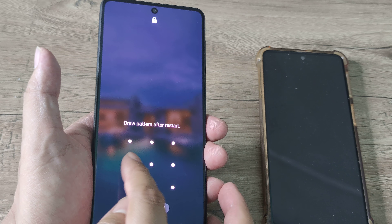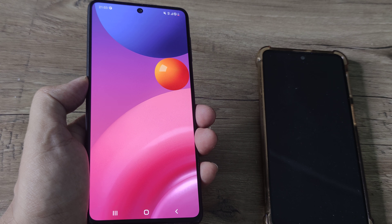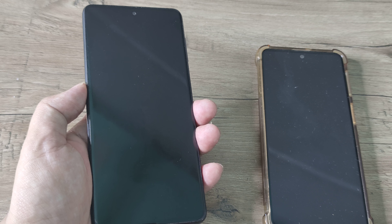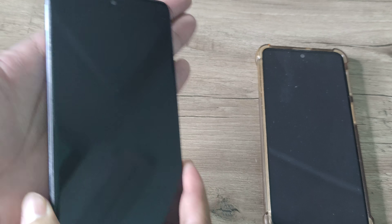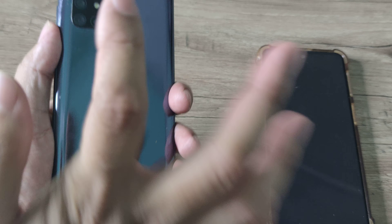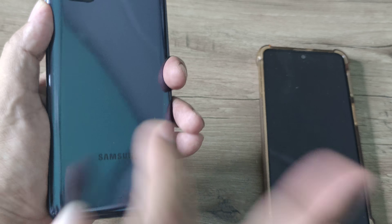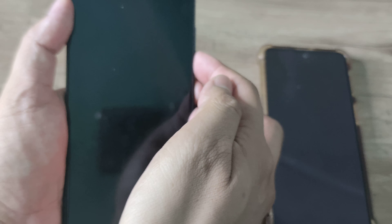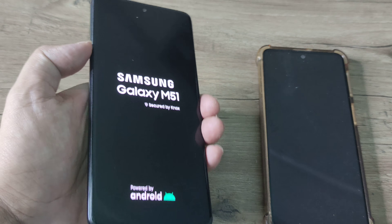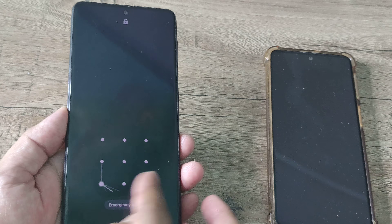The phone has started. Now just put in the screen pattern and you can see the phone is not stuck in a boot loop — it's started normally. If this doesn't work, there is a third method: the tap method. We've seen the smacking and the massage; now is the tap. Keep tapping the phone firmly at the front and then at the back as well. If anything has gone loose, it will get back in place. Once you do this, again do the force restart — hold volume down and power until you see the Samsung logo, then let go and let the phone start normally. The phone has started; simply put in the pattern and there you go.